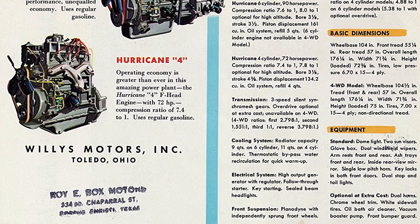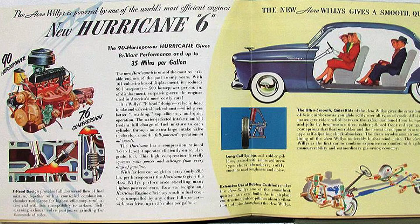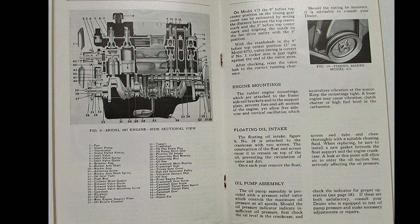The intake manifold is cast into the head. It has a fully pressurized oiling lubrication system to the main bearings, connecting rods, and camshaft bearings. The crankshaft is balanced and fully counterweighted, riding on four main bearings. It's important to note that both the four and six use partial-flow oil filtration via a canister mounted to the outside of the engine block, with oil lines trickling oil back into the engine. Oil filtration is a huge weakness of these early engines.